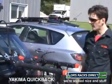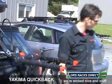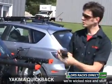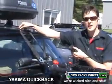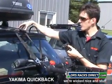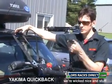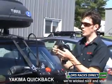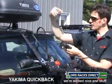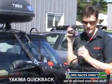Pretty cool. Now, the other thing that I must point out that's very important are these glass hatch hooks, which would replace the top hooks if your vehicle has glass or something other than metal to attach to. And the Fit Guide will tell you that you should use these as well. So they basically work the same way. This piece goes in and then the strap comes through and then runs through this hook here. So you just replace those top hooks.